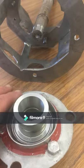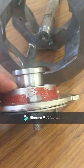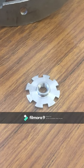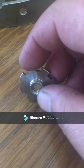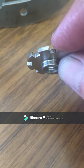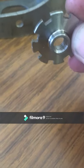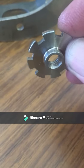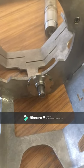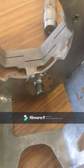We will now look at fitting the retrofit bearing assembly, which has been assembled from the factory in its correct order. The first part to go back into the oven is the adjustment nut. These have a machined shoulder on them — the shoulder goes down and references into the 4mm thick bearing plate. Three of these go in first, shoulder down. Wind them all the way to the top of the thread and back them out approximately one half turn for a baseline setting.